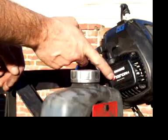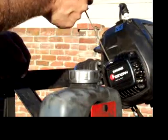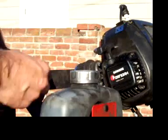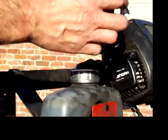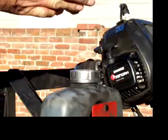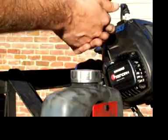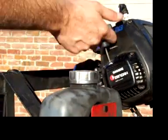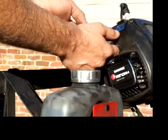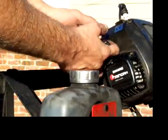The only thing, if you run a plastic ring, it'll eventually wear like normal, but they all wear a little bit. Definitely won't be any more blowing up pull starts because there's no interference fit. These actually were rubbing against the prongs and touching all the time, whereas now it does not touch until you engage the pull start. Now you can yank really hard on your 460s. Yank that 460.